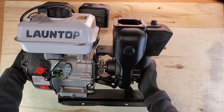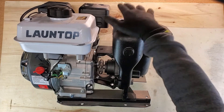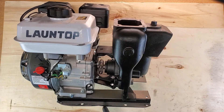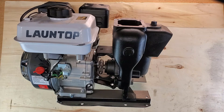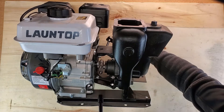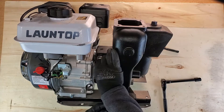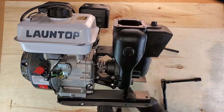For the purposes of this video, I've removed the front spout and the top valve mechanism in order to make it easier to film. First thing to do is remove the clamp holding the shaft onto the impeller — you're going to need two 13 millimeter sockets or some combination of sockets and wrenches. I'm going to go ahead and speed this up because it's not that exciting.